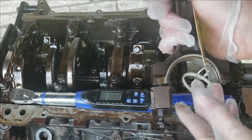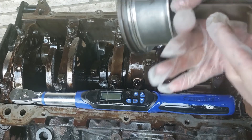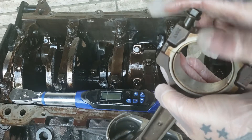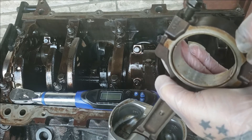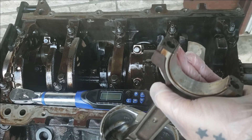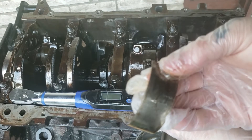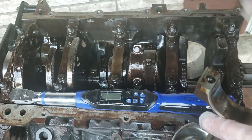This is cylinder number two — I got it tagged, as you can see. We don't need the tag anymore as it's going in the motor. The first thing you want to do is clean up your pistons extremely good with brake clean and remove your old bearings if they're still in it, because we are replacing ours. I recommend replacing your bearings anytime you're in a motor — even if they don't need it, why not?